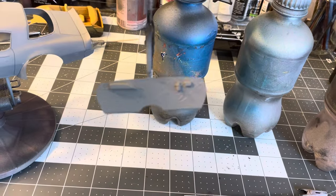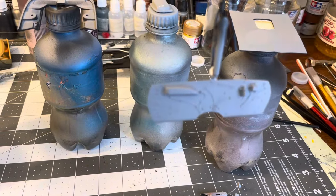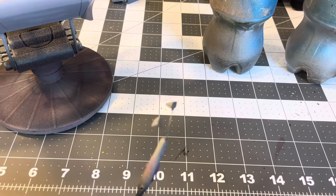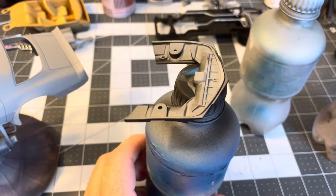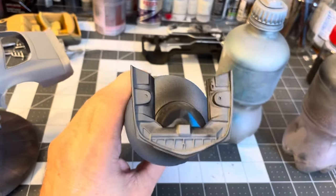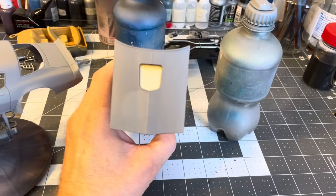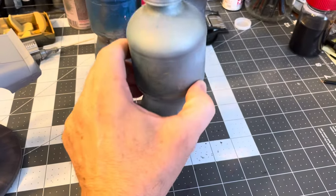Parts will be painted in black first and then the body color. Here's the firewall, and the mirrors I'll do separately. The engine surround and the pin at the bottom — flat black first, then Blazing Black to match the body color. Same with the hood underneath — I did flat black.